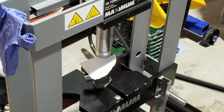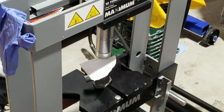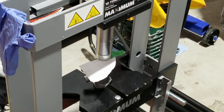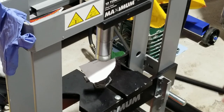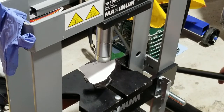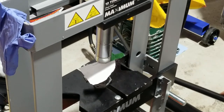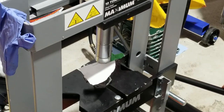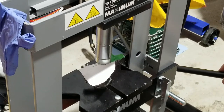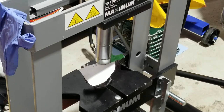Oh, it's going in very smooth, although the first part is not really pressed yet. It's almost no pressure, the gauge is not even moving yet. Parts are well lubricated. Okay, now I can feel some resistance. Now is the time where I'm actually pressing it. It's still going very smooth, well lubricated. Okay, I think I'm flush here. I'm gonna have to ease off and check at the bottom if I'm flush at the bottom. If not, then press a little more.